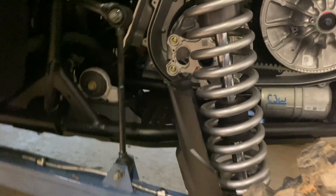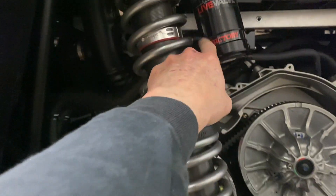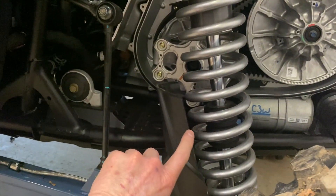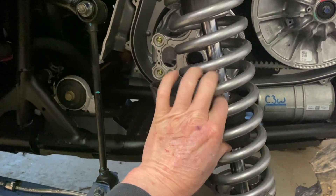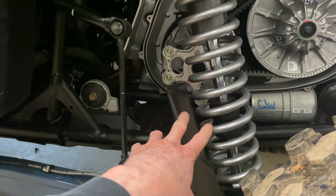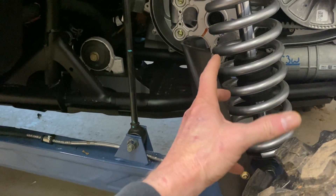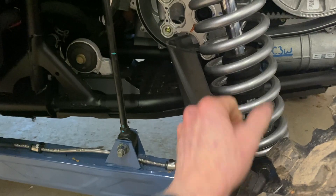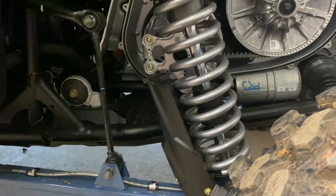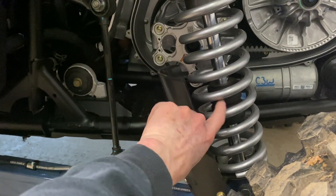Another thing to note on the shocks — they're indexed here, so pay attention to orientation. The guards always face the opposite side, and you can look at your eyelet up top or at the bottom to get them lined up; you can still adjust once the shock is in. The other issue was the little bump absorbers. Don't try to just pry through the spring like shown in some videos — the best approach is to find the slot in the piece and press down through it using a screwdriver or something slightly more blunt. Press right on top and keep momentum; it'll push all the way down. The first shock took a long time until I figured that out — after that it went really quickly.